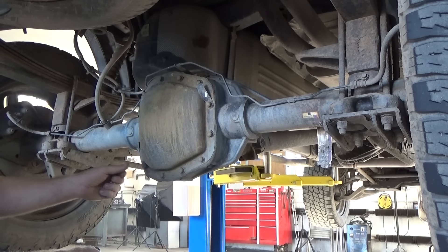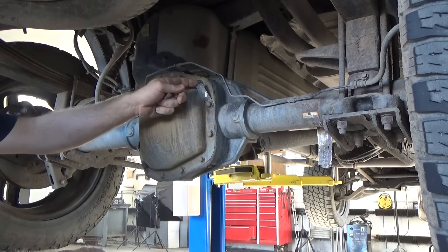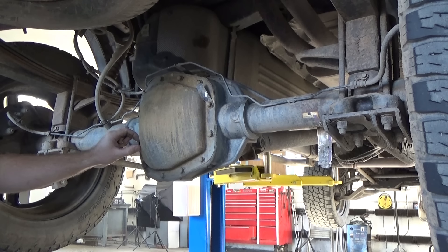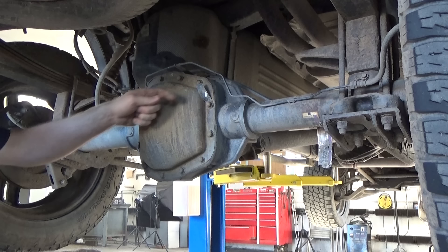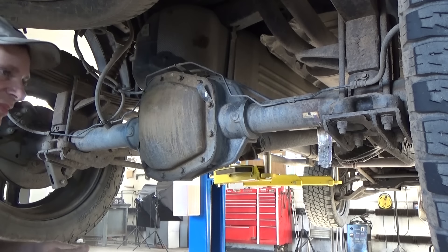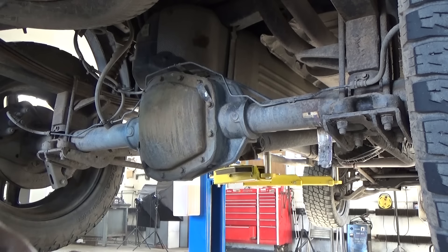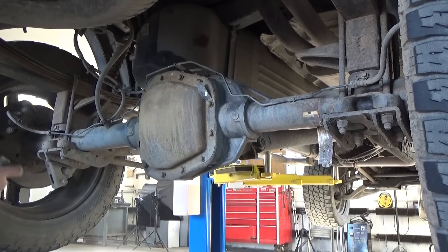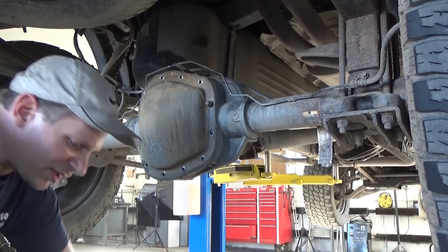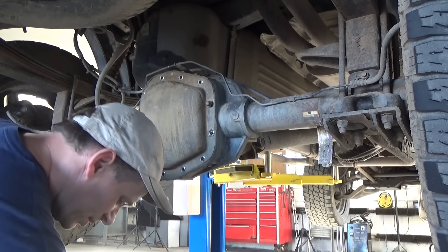You can tell someone's been here in the past — it's got a lot of silicone. It's got two different tags. One tag has the information: V-953, 3L73975, 9E24. The other tag shows the oil: 75W140 Synthetic. The vehicle's been lifted. It has one new rotor on one side and one old rotor on the other. He said he just had an axle bearing put in it. So we're going to break all these loose — 13mm.